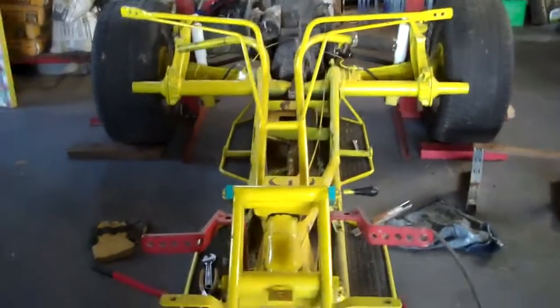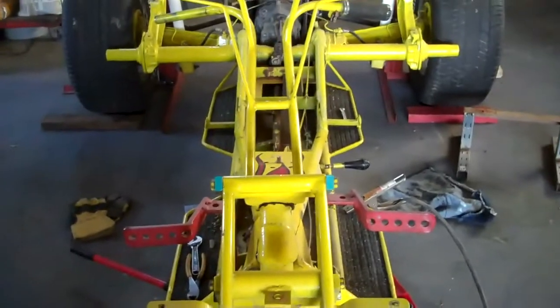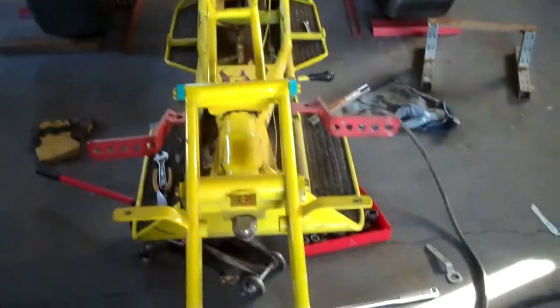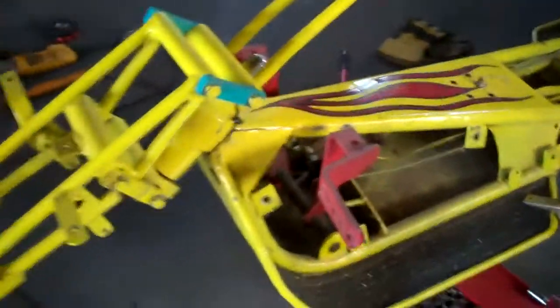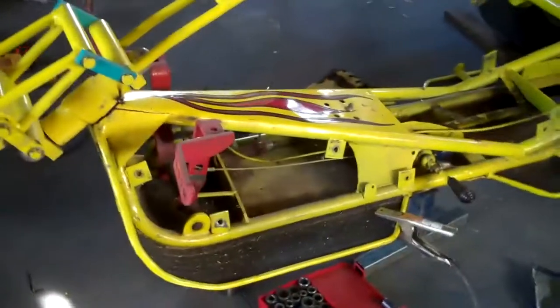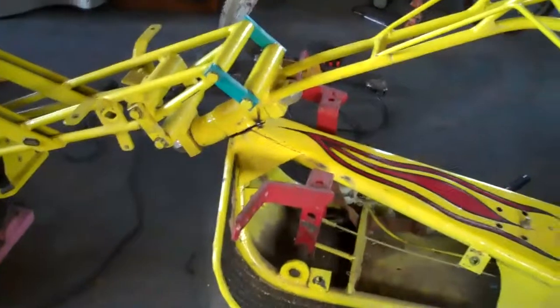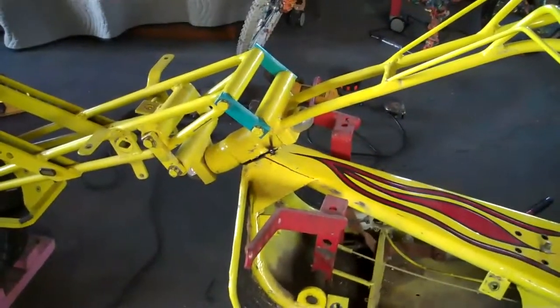The handlebars are going to come off for refitting because they don't fit my brother. And that's how I straighten the front end. This isn't the first time I've had to do this to scooters where, for whatever reason, the head got improperly placed or got bent over. So I cut them loose, move them, and weld them back up again.